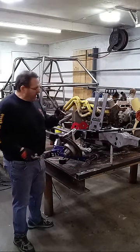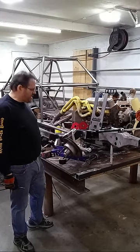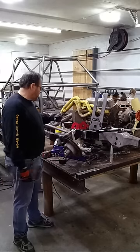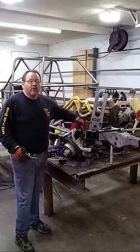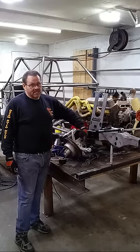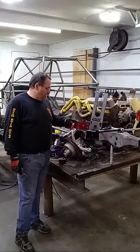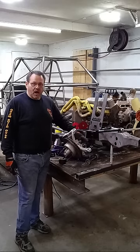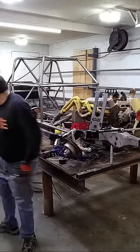But that Chrysler upper right there, I think the upper, is it a 727? One of them's a 777, one's a 727. I don't know which is which, but anyway. It's 7 degrees on the top, 10 degrees on the bottom. They're not all 10 degrees on the bottom. This is like a QA1 bottom that's for a GM that's 10 degrees. I think a stock Chrysler is 7 degrees on the bottom as well. But anyway, 7 degrees on top, so I gotta set that.